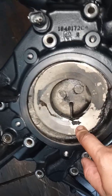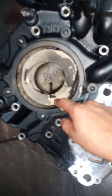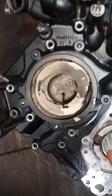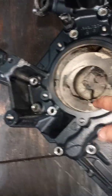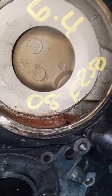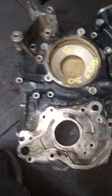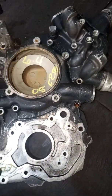The only thing you can do at this point is get a replacement timing cover — new ones are about $400, used ones you can find at scrap yards for around $150. When buying a used one, make sure you check it for cavitation marks. This one I bought for $150 is in perfect shape — no cavitation marks, just surface rust from sitting on a shelf. It's a good used cover pulled from another engine. Good luck with it, have a great day.